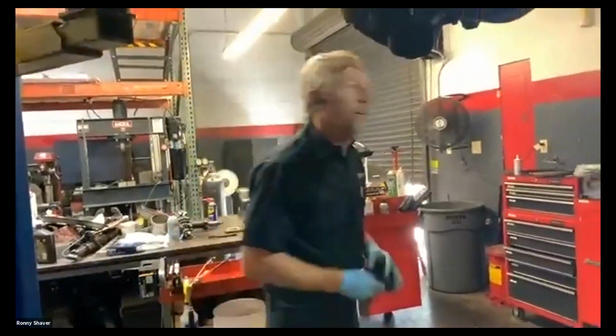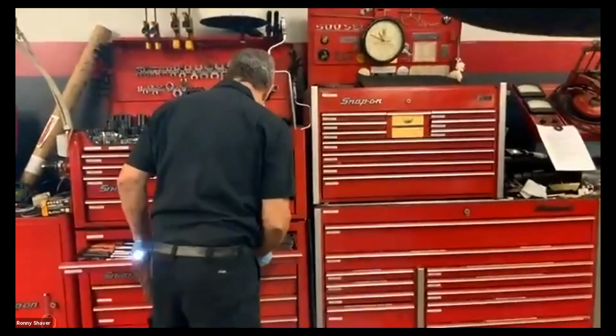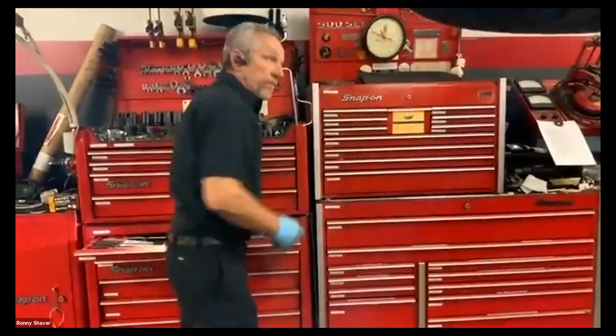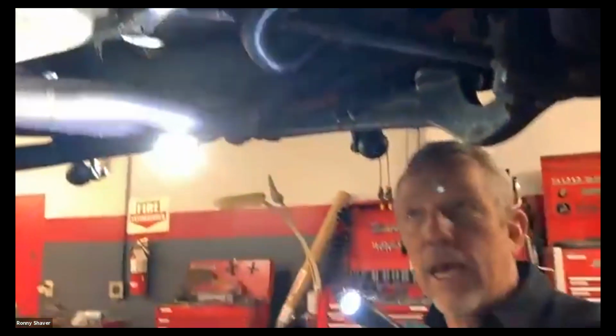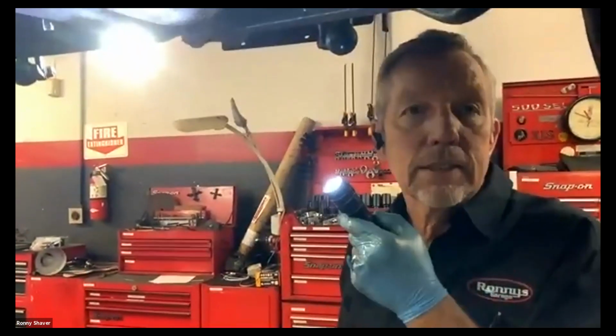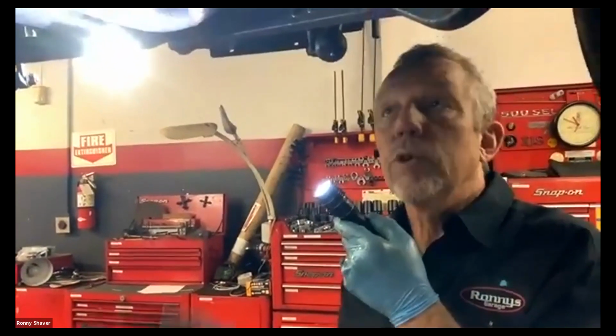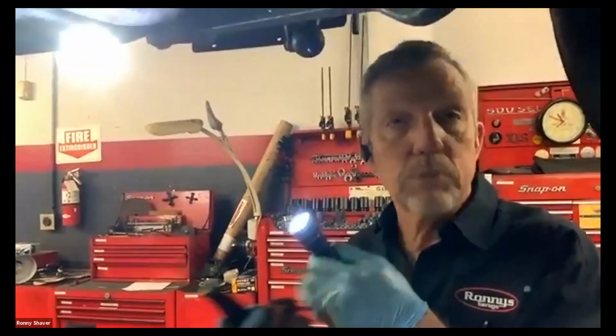All those things. Another thing you want to do is on the oil level sender, which is on the, let me get a screwdriver. There is an oil level sender on the side of the block. Your fuel gauge doubles as an oil level gauge. There's a test button on the dash, and on the fuel gauge, you'll see a little orange line that says min oil. So you can actually check your oil level from inside the car without using the dipstick. And that's what this guy's job is.